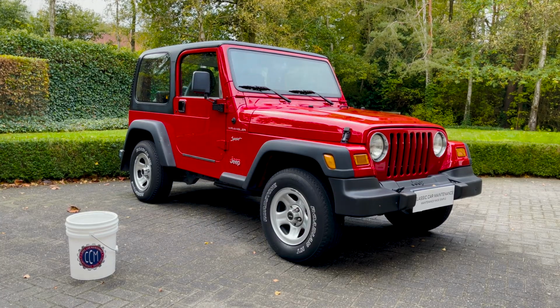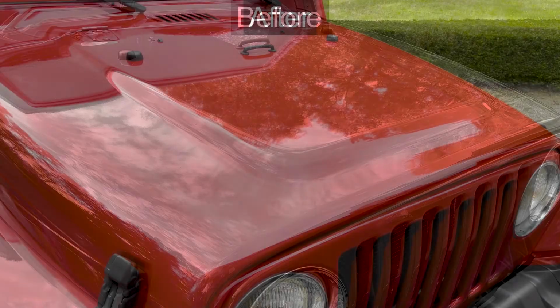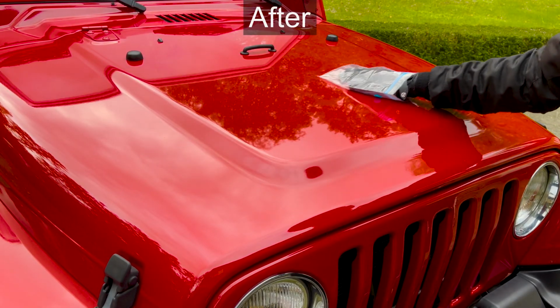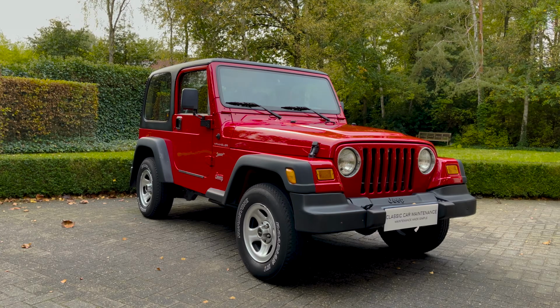Now let's do the zip bag test again. Gently rub a plastic zip bag wrapped around your hand over your car paint. It should feel like silk and the scratchy noise should be gone. If you're not satisfied, go back and clay some more. Some areas may need extra claying. Typically, around the exhaust there's a lot of soot. Behind the wheels you'll have the most brake dust and the front bumper area may have hard to remove bug guts.